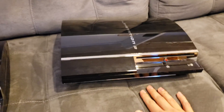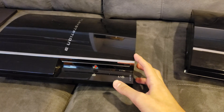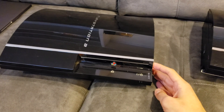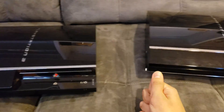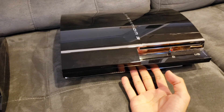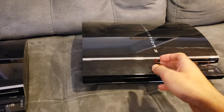Another thing you can do is install a custom ROM into your PS3 — like if you go ahead and start hacking it, which is actually something I've done with this one. This one has a custom ROM installed and it has a piece of software called Fan Control Utility. What that software allows you to do is control the fan, and it has an auto mode that keeps the temps in general much lower than stock. One of the issues is that Sony's regular PS3 firmware, with these older PS3s that have old thermal paste and all that, they'll idle around 70 degrees Celsius, sometimes 80 degrees Celsius on the cross-media bar screen — which is really bad.